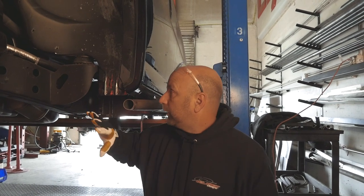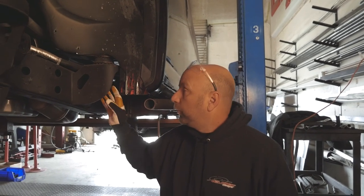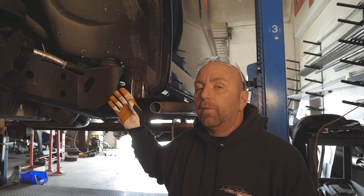This video is for all you Chevy Express van owners. We all know that you want to run bigger wheels and tires on your van. One thing that can get in the way of that, depending on the wheel offset, is this mount right here. A lot of times when you're turning, your tires will want to rub this. So on this episode of Tips and Tricks, we're going to show you how to get more clearance by cutting this body mount off.